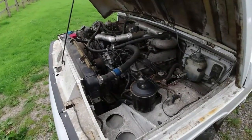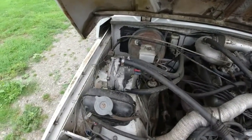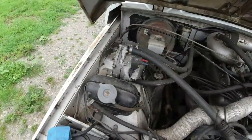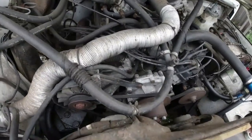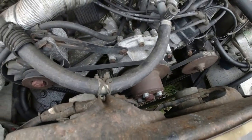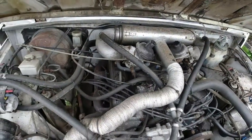Now, because of all this with the Luxembourg MOT and so forth, I think the Luxembourg owner fitted the car with LPG, and that's what all of this shenanigans is here. It's plumbed into the cooling system. There's quite a lot of it going on. The gas pipes, everything's got to be quadruple tie-wrapped in. You can see the attention to detail here. So it's got quite a lot of stuff fitted in and around it, which I'm going to be taking off.